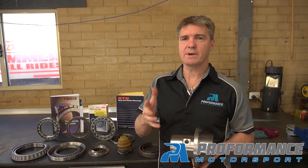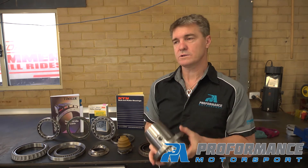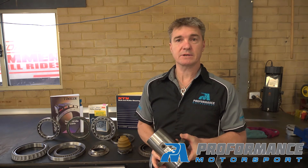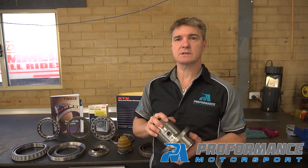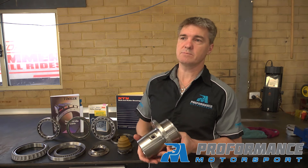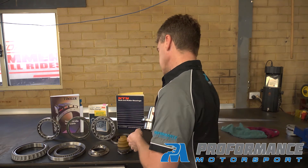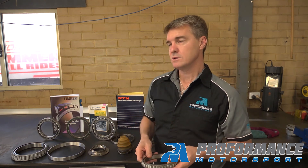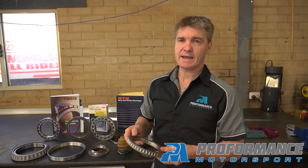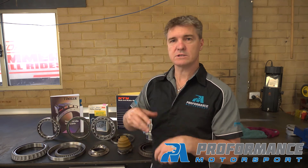In addition to selecting the right bearing and the right lubrication, it's important not to over-flood the bearing with too much oil, or have too little oil, or use the wrong type. You might see some ports in this pinion carrier here, which prevent our products from over-lubricating the bearings and becoming heat generators. It took us nearly five years to understand why the pinions in our product at 100 miles an hour generate a little more heat than the rest of the differential. After lots of research and reading all these manuals and books and advice from lubrication engineers and bearing engineers, we've determined the ultimate saturation point for a bearing — the amount of oil that the bearing needs to sit in. Too much oil, the bearing generates heat; not enough oil, it won't get sufficient lubrication. So our products have been engineered with feeds into the pinions and exits out of the pinions to ensure the pinion bearings don't sit in too much oil.